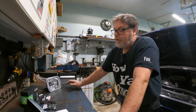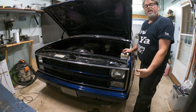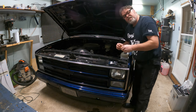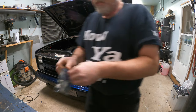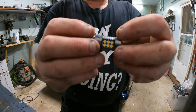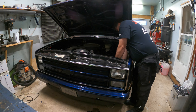So what I'm going to start with maybe is putting in the front marker light bulbs. If you turn this way you'll see here's the front of the truck right here. Yesterday I put a bulb in here. I'll take that bulb out - the 1157 bulb - and I'll put in an LED 1157 bulb. It should be pretty nice. These bulbs are pretty cool looking. They got like a little ding dong on the front and multiple LEDs.